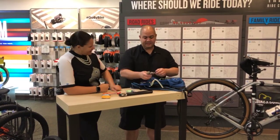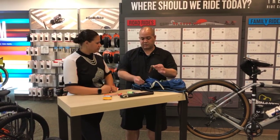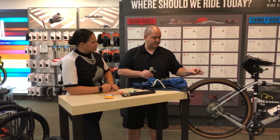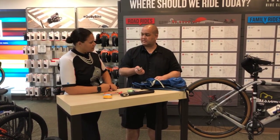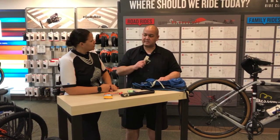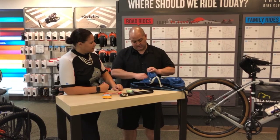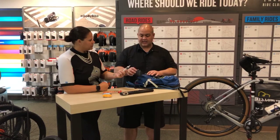The other thing I carry — and this is typically for longer rides, not necessarily for a shorter commute — is a chain tool and a master link. In the event that I break a chain, typically if there's a chain failure you're only going to break one link: cut it out and replace it with a master link. We're actually going to go into detail on this in a couple of weeks. The big one I am going to show you today, because it applies to everyone on a pretty regular basis, is the CO2 — that's one we get a lot of questions on.